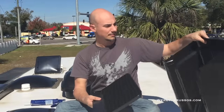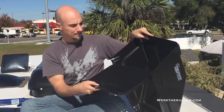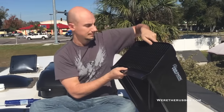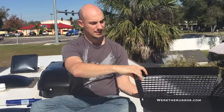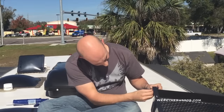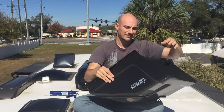The first real step is installing the grill on your Fantastic vent cover. There's a little tab here that aligns up with a hole — slide that in and it connects. Then there are two push pins that go on either side, and that's that.